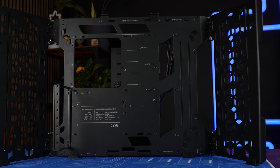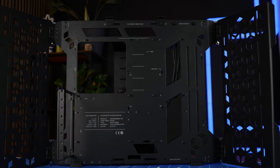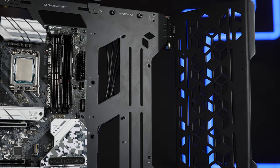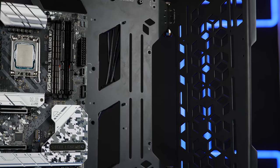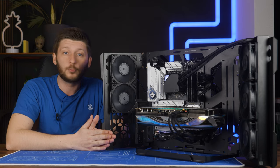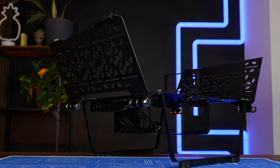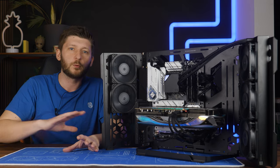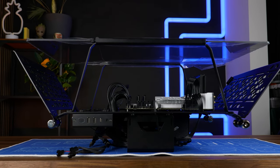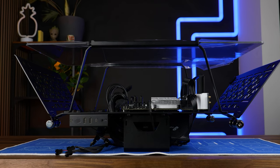For both modes, you get pretty much the same level of hardware compatibility. As far as motherboards go, you can do whatever you want — from Mini-ITX all the way up to EATX. Just keep in mind that once you go beyond regular ATX, you will lose the two rails that can be used for water cooling equipment like pumps and reservoirs. And here we already face the first issue: CPU cooler support. In test bench mode, you can go as high as you want — there's nothing above the case. But if you choose the regular route with glass installed, you're limited to 158mm high coolers, which is not a lot. Nobody forces you to use the glass though — just don't, and the problem is resolved.